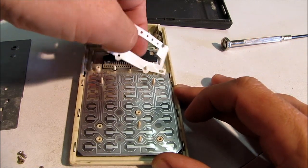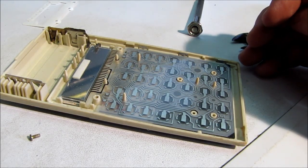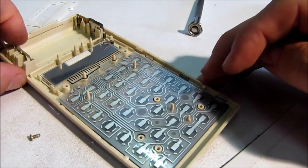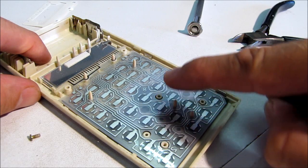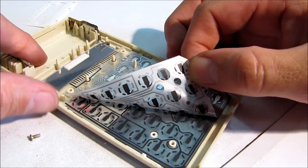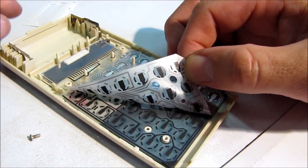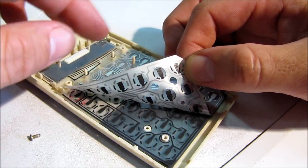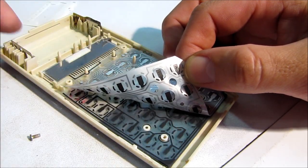Remember the order that you take these things apart. What we need to do is trace and find out which pins we want to be connecting with our wires. How a keyboard works is you'll see they've got these silver tracks on top, which are printed on a piece of plastic. Underneath there are other tracks also printed on a piece of plastic but separated by a layer. When you press the button, that pad will press on that pad and it will be like a switch.